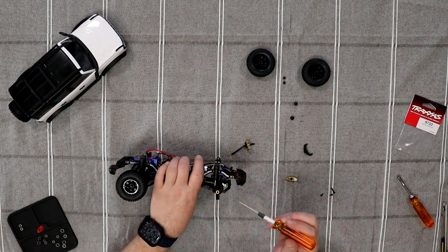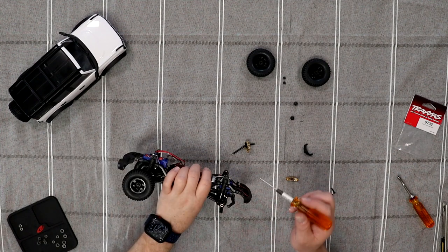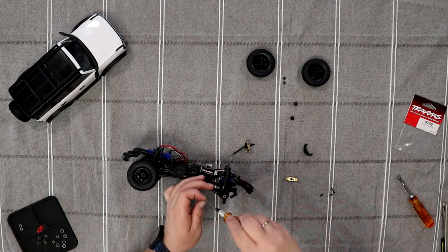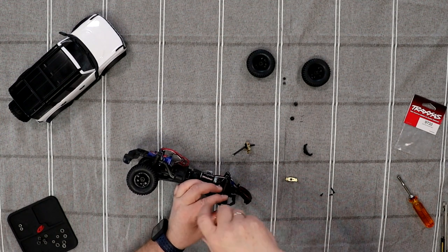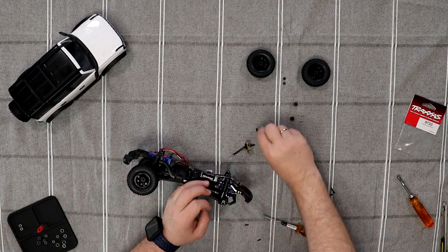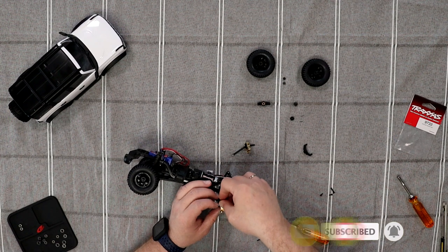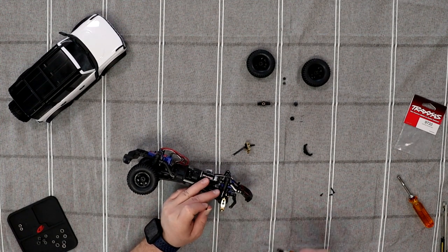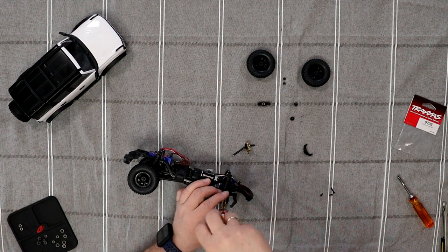You will see right here there are two bolts in the middle where the bushing is. You are going to remove those two bolts. Keep those bolts — you will need to reuse them. Put that aside. You are going to grab your knuckle and just put those two screws back. When you are going to tighten these back on, snug only. If you over-tighten them, you will strip your plastic.